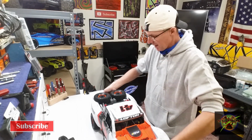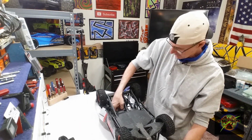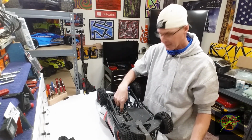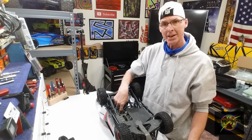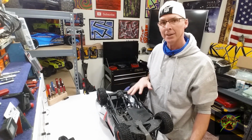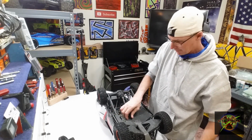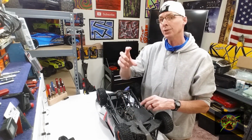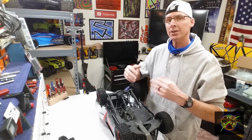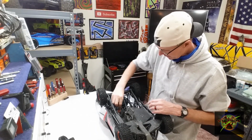I've really enjoyed this. On the underside here, your battery tray is right here, and you flip this switch and pull out, and the battery box opens just like that. Now, I've gone to the trouble to change over my connectors to the EC5 connectors because those are the batteries that we use here. Other than that, this is unchanged. The batteries simply drop into the slot, and it'll hold stacked 3S batteries to give you a total of 6S. I run 6S batteries already, so I don't have to do the stacking, so I do have the loop connector in line.